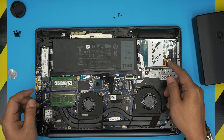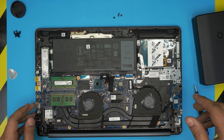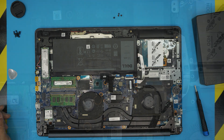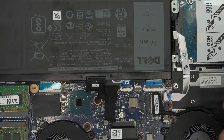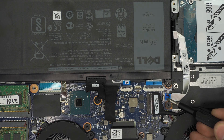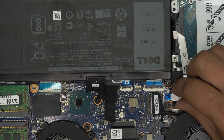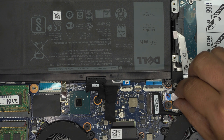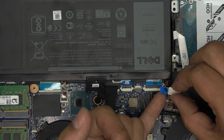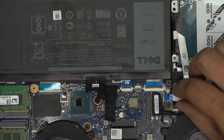Before removing the hard drive, disconnect the flex cable — this is tricky and people often damage them. Put your finger under the lock and lift it up 90 degrees to open the lock. Don't pull the connector straight out; bring it up at a 45-degree angle then pull, because of the earlobes on the sides of the flex cable connector.